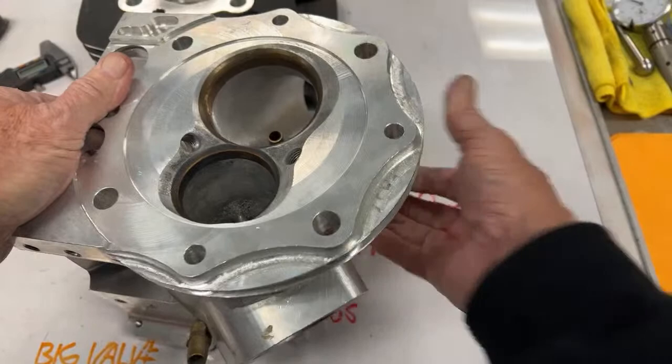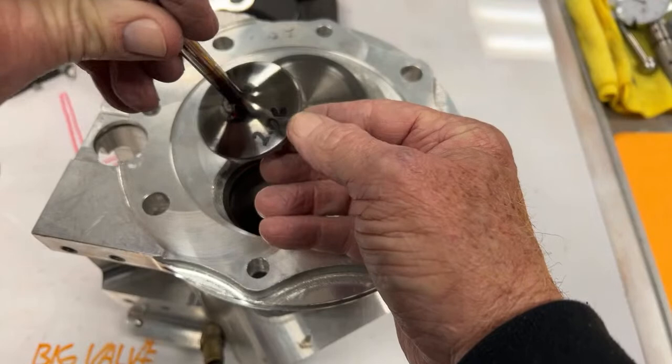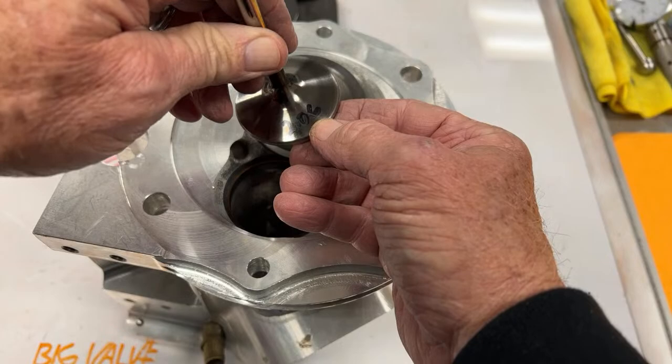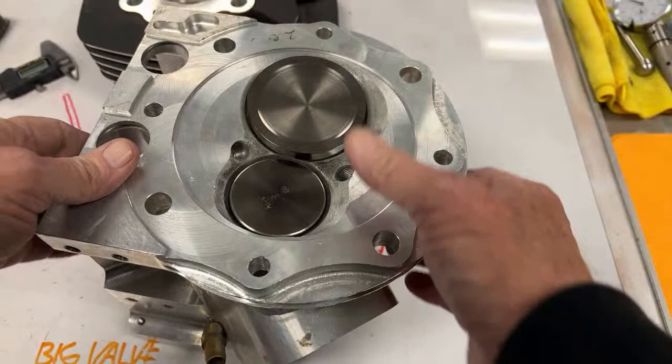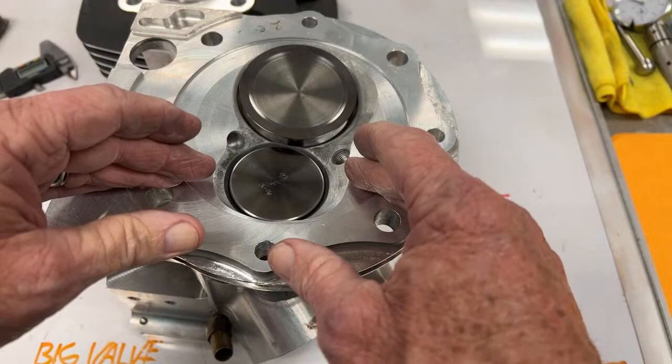So then, when we would put the biggest intake valve we could, and we put the biggest exhaust valve we could. This one is only 2.06. We ran, at the end, we ended up running 2.10, which is only a little bit bigger than this one, but the bigger exhaust valve we ran, the better it would run. Not bigger than the intake, not bigger than anybody else in the world, but what we found with our combination was, and I'll tell you how we found it, when we have a big pipe, we'd make more power.